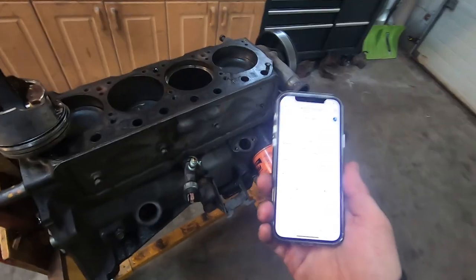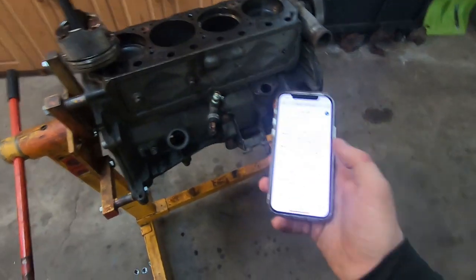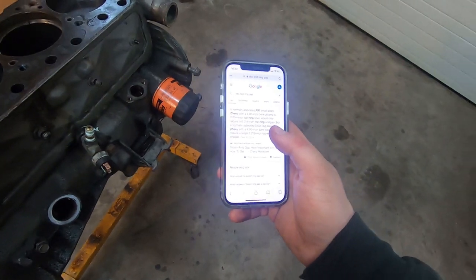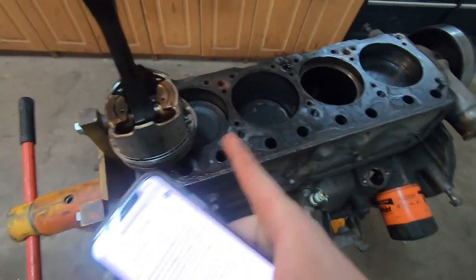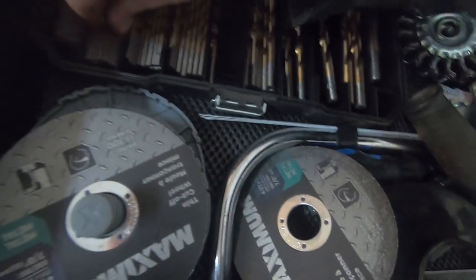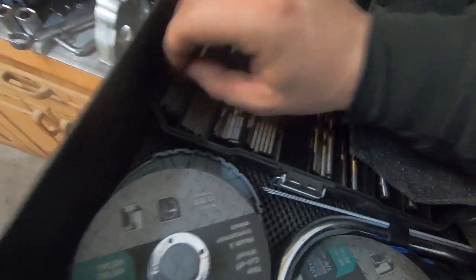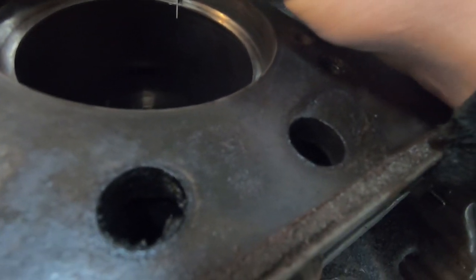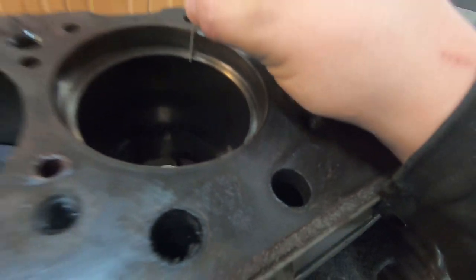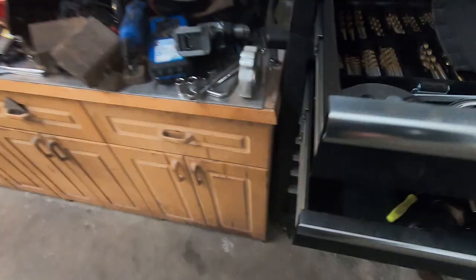She's got some gap. I did some digging — I couldn't find much on a 2.5 ring gap spec, so I searched for a 350 instead which is very similar. A 350 requires a 0.016 ring gap on the top ring, and this is significantly larger. I could probably check it with a drill bit. A 3/64 of an inch drill bit fits in there pretty easy with still a lot of slop, so let's convert 3/64 to decimal — 3 divided by 64.